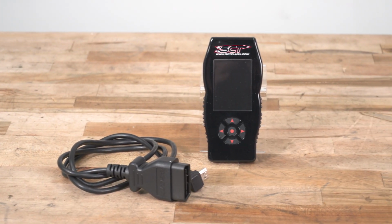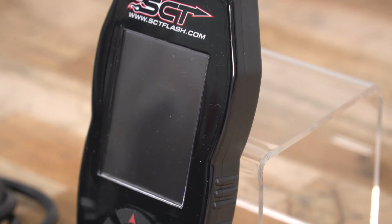Now 5-Star is going to take, again, a number of things into consideration, such as fuel strategies. The factory tune is a little bit lean in the fuel strategies, and they have moderate delay timers before adding more fuel, especially at wide open throttle, which can be a problem when trying to add more power and torque, especially at the top end. 5-Star safely calibrates that in a way that adds a little bit more fuel at the top end, which is going to net more power.